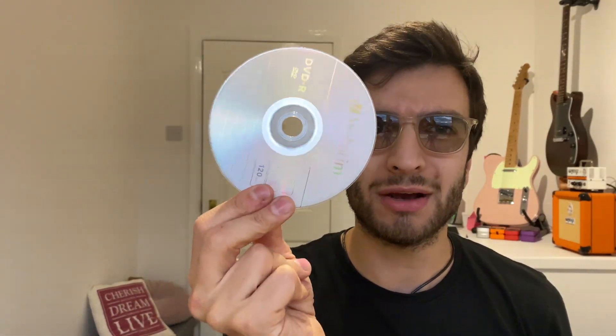I'm going to stop the video right there because what ensued was hours and hours of misery, because as always with Evolve Tech, it never quite goes to plan. Basically, to reinstall the OS needed to run that Mac, Apple have switched off their service, so you can no longer download it directly from the internet. You need to make a bootable drive. The disk that came with the laptop was the wrong OS — it was like Snow Leopard, basically not compatible. I had to make a bootable drive of Lion. If you'd like to know how to do that, please leave a comment and I will show you how. It's a couple of days later and we have a working laptop.